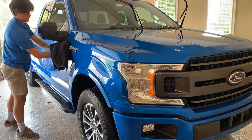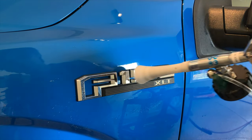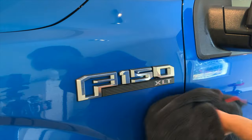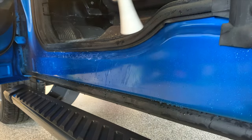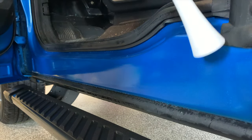It's important to get all the water out of the tight spots because that water can be shaken loose when compounding or polishing. If there's dirt in that water and it runs down into the pad without me seeing it, the machine would be pushing and spreading that dirt around the paint rapidly, causing scratching and more work for myself to go back and fix.